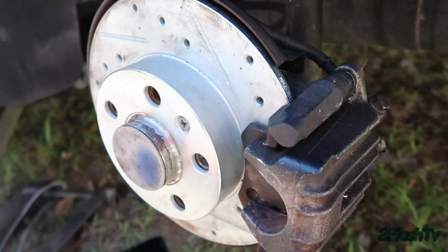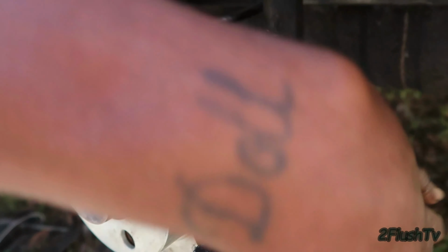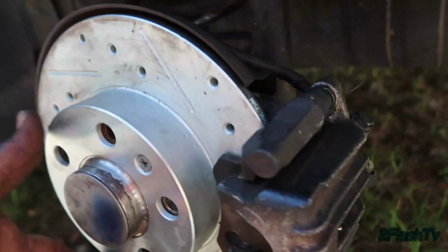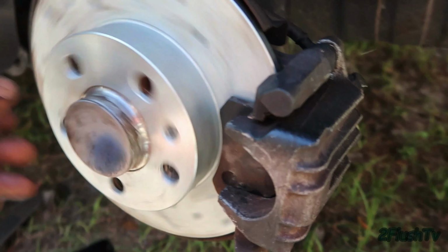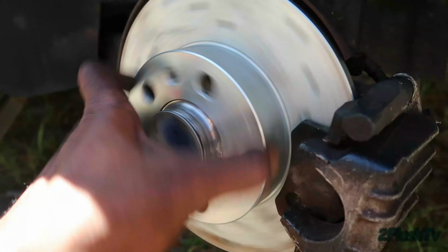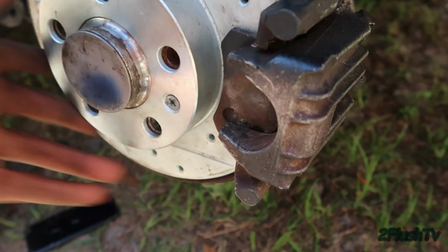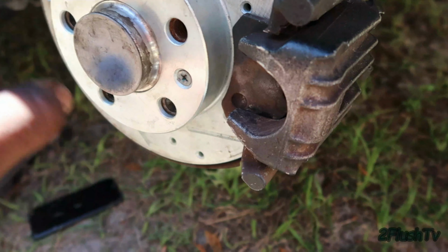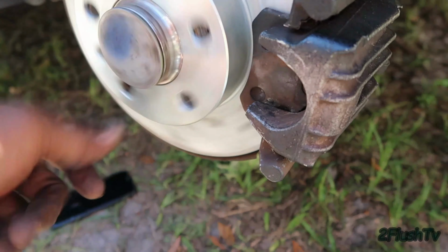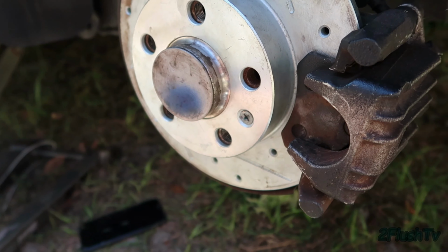All right, now it's all back on there. New brakes are in. Both bolts are hooked back in there. Brakes are in, and I can freely spin this now because I know last time this was a problem. I could not freely spin it, and when I tried to go into first gear, I was stuck because this brake was not free to spin. So double check that. Now let's put the tire back on there